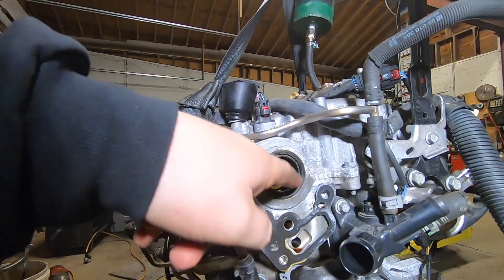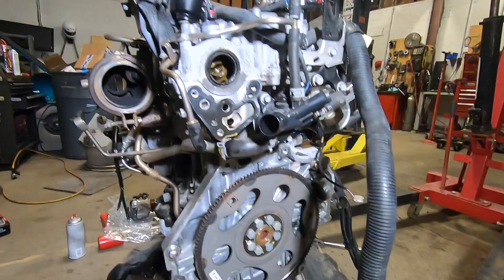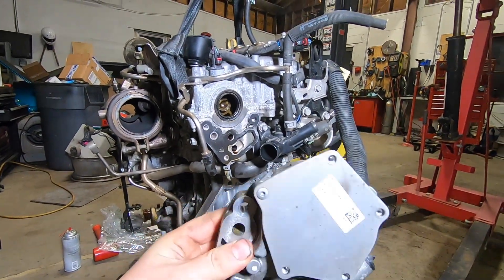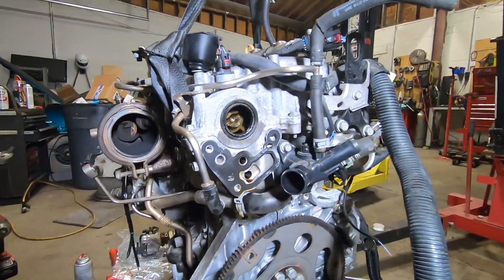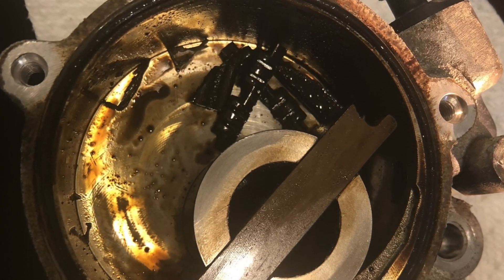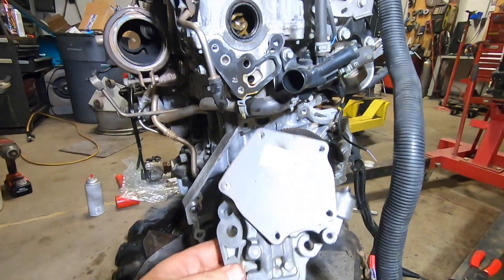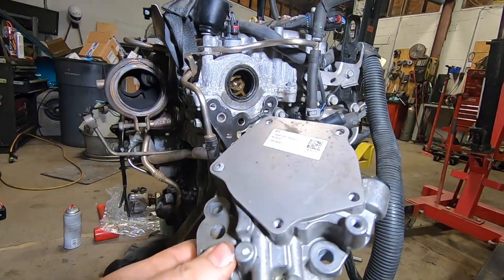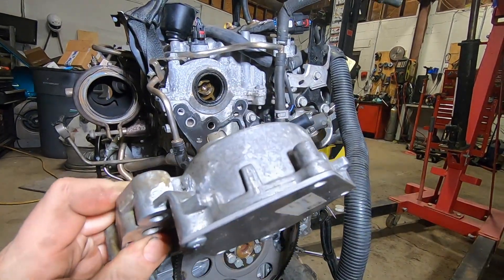You've got an oil screen right here, a little oil baffle here, and then a suction port up here that provides the vacuum to your brake booster and other things on the car. You've got an oil seal here — these don't really seem to fail — and then you can see the two oil ports on the engine. The reason this is important is that when this pump fails, not only do you lose vacuum, it can potentially bind up and cause damage to the cam, whether it jumps the timing chain, cracks the cam, breaks the tangs off of it, or just causes other mechanical issues. So it's probably good to replace these pumps on some type of routine maintenance, but let's tear it apart and see what fails.